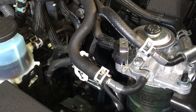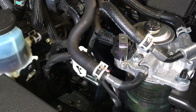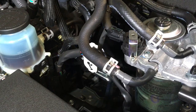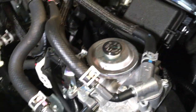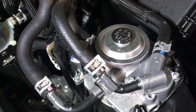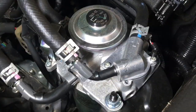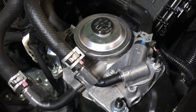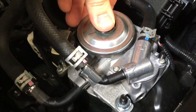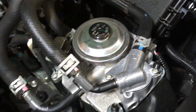What do you do if you run out of fuel? Firstly, you need to get fuel and put it in the tank — that's obvious. But for a lot of people they're not sure how to prime the system. If you do run out of fuel on a diesel, you find your fuel filter — it's got the pump on top. Once you've got fuel in there, pump it like that till you see how it's gone firm — it's got fuel there.